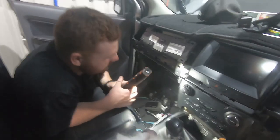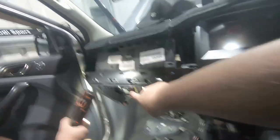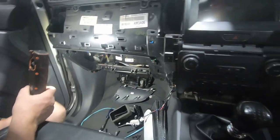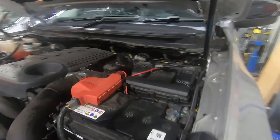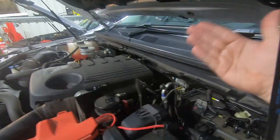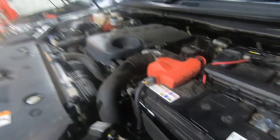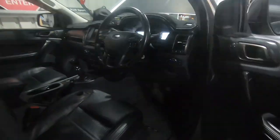We've got the dogs in here because it's raining. Connor is just running wires in the cab through from the firewall. We have the harness here with the TowPro box, and we're getting that up to our little console. The power side is pretty straightforward — you've got a positive and a negative; wire them straight to your battery or an accessory source from your fuse box. Check your operator's manual to see which is constant power and which is accessory power. That's all sorted now.